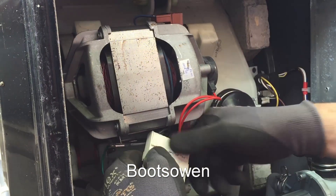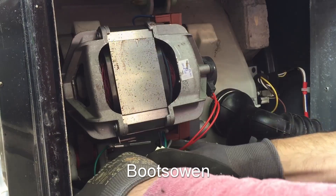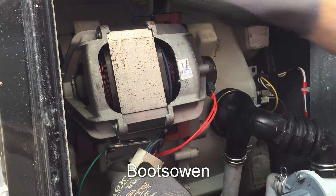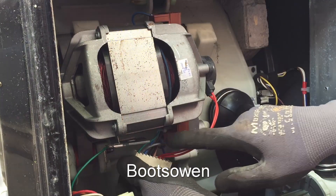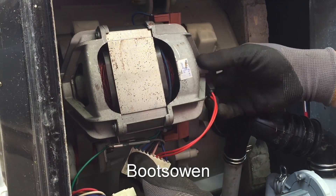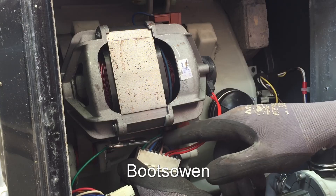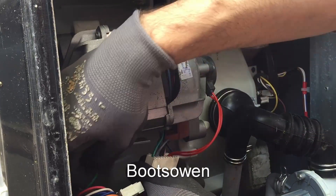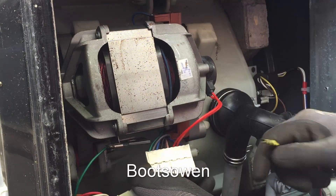This should come apart — there's a little clip on it. If we look underneath on this connector block, we've got a grey cable going to this brush, and a blue cable coming from the brush on top. The red ones here come from the tachometer — I can ignore them completely because I don't need them for hotwiring it. I need power coming into a brush, jumping from the other brush to a coil, and then jumping from a coil out. Since green is sometimes earth and there's another green here, I'm going to avoid the green one and just try a combination of in and out with the other cables.